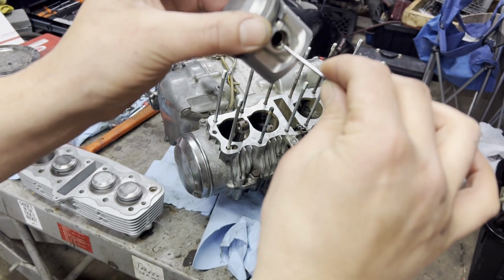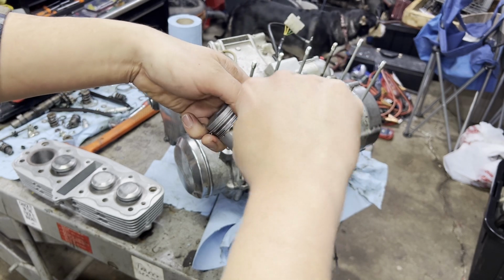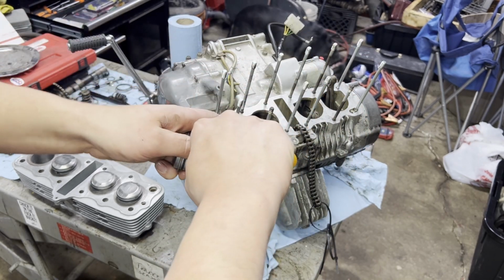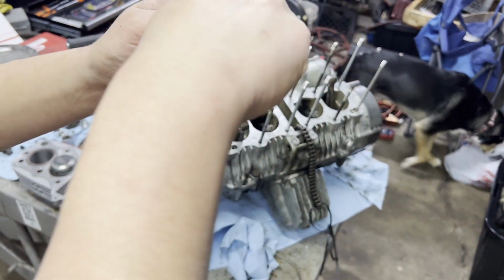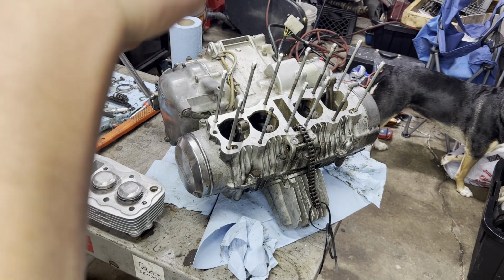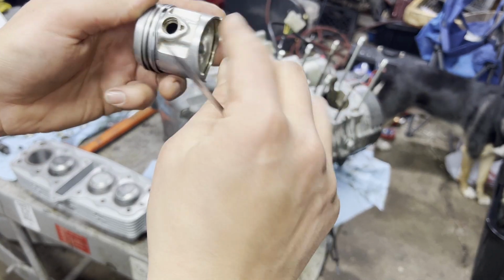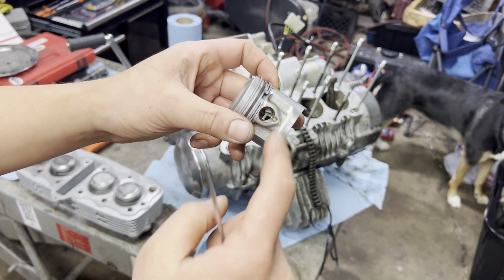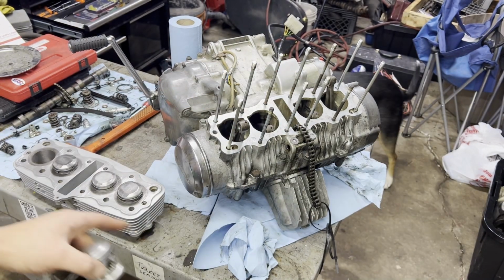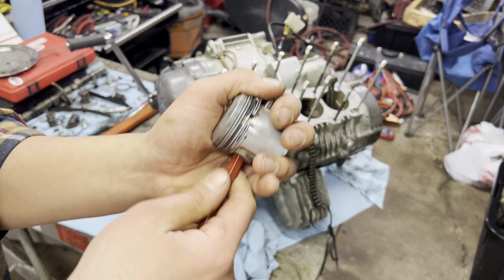It's a little snap ring, put it in, pry it up out of the groove, work your way around it. Little flathead works really well here too. But it's just a C-clip, essentially. There's no crazy way to go about doing this. Just gotta get it up and out of the groove. A curved pick works a lot better. So let me retool, pop this out, I'll show you what they look like, and then we'll come back when we're ready to start putting these on the motor.